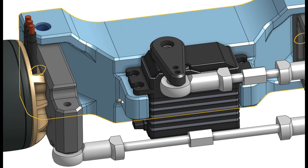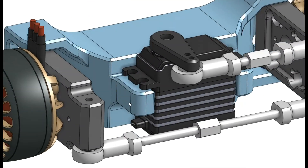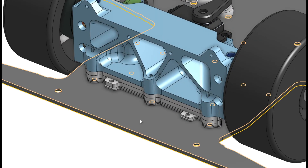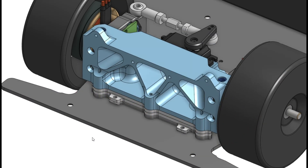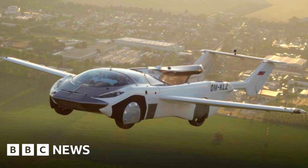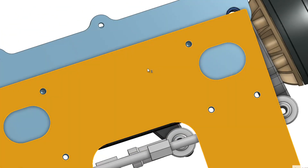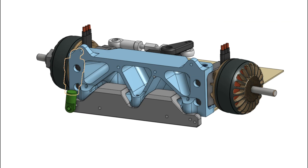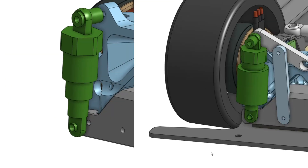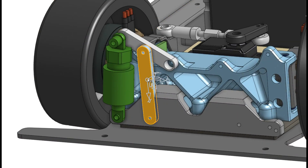The servo mountings could now go directly on the bulkhead, reducing the number of parts, so things were looking nice and simple. But then I decided I wasn't content to do a rigidly bolted front chassis — I wanted to have provision for suspension, to help keep the wheels on the ground for traction, and reduce the chance of upsetting the aerodynamics and the car taking off. So I added mountings for the carbon leaf springs that I already had. Then I decided to add shocks, working in the pulling direction to add some damping. And then I decided to look at even adding a linkage. See where I'm going with my tendency to add complexity?